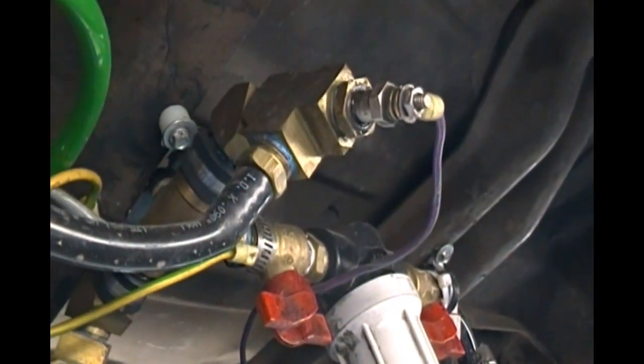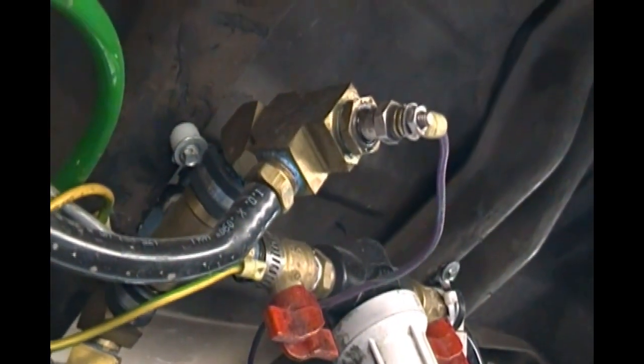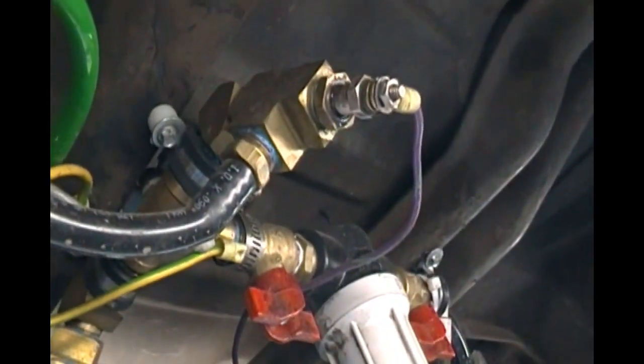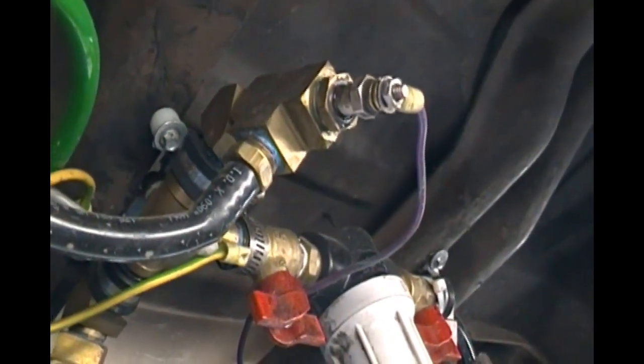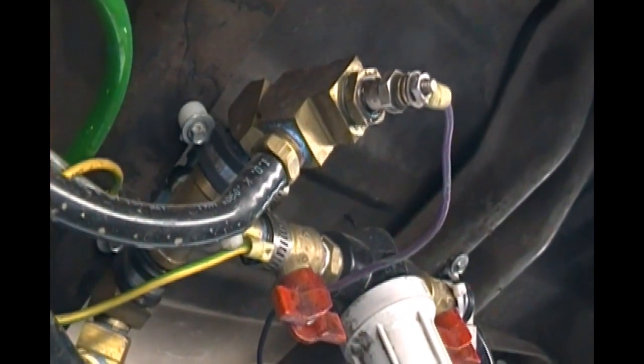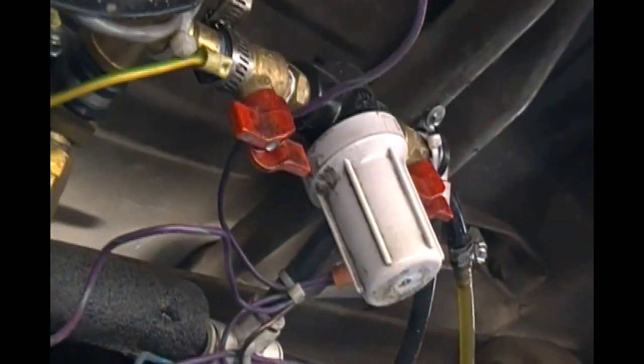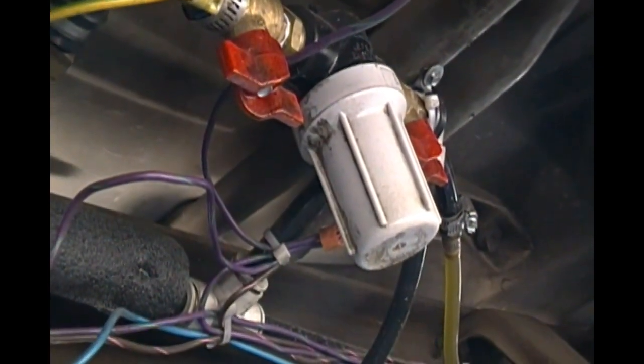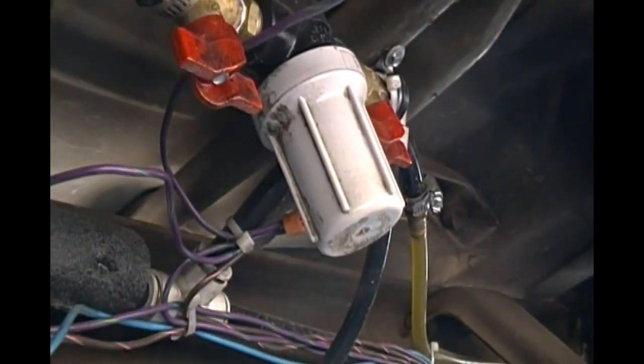But when I select the front tank, which is vegetable oil, then we have those electric glow plug heaters coming on to get the fuel heated up before it goes through the strainer, so that helps to prevent the strainer bowl here from getting all gelled up.